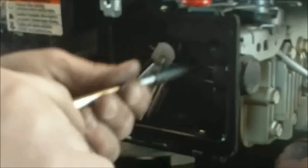Snug them up a little. Don't torque them. Get them started first, then snug them up, and after they all snug up, then you can tighten. Don't overdo it, you'll strip something or break something. You want them tight enough so they seal and don't back out.